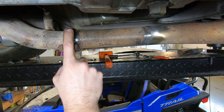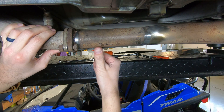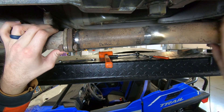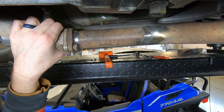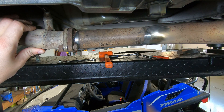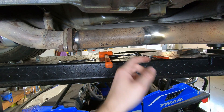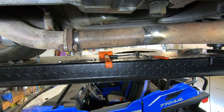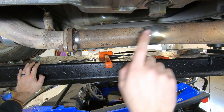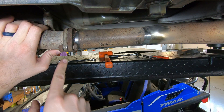This flange is at a bit of an angle, so it's kicking the pipe either away from us or towards us. Kicking the pipe towards us was the best way to go so we're not hitting this brace — we are really close to it. After removing the rust, I'm going to weld on this. I thought I'd just put a couple of tacks on each side and pull the exhaust down, but I'm going to do as much welding on the car as possible because the way they're sitting right now is absolutely perfect — if this were welded, we'd be done. The only things left are to weld these up so they fit just right, and to get new gaskets since these ones are pretty beat.